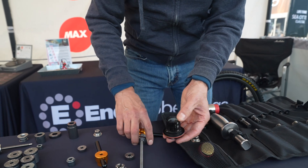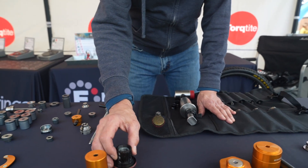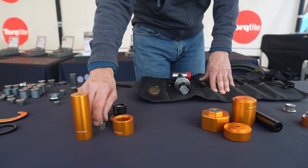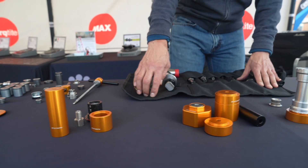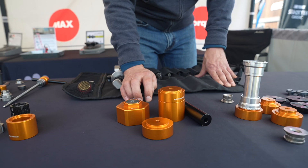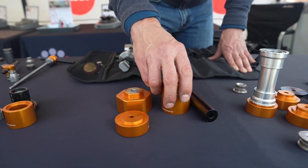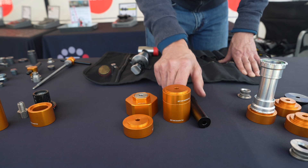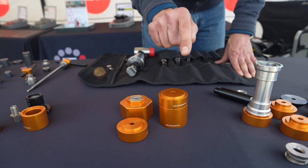So that's the BRT60 putting the bearings back in place. We used the BRT41 to remove those bearings — that's for bearings without axle stops. Then we used, before that, the BRT40 to remove the bearings with axle stops. In our case we had it on a six bolt hub, but you can do it for center lock, or on the drive side, because we know how long those drive side axles are, so we need to have that space.